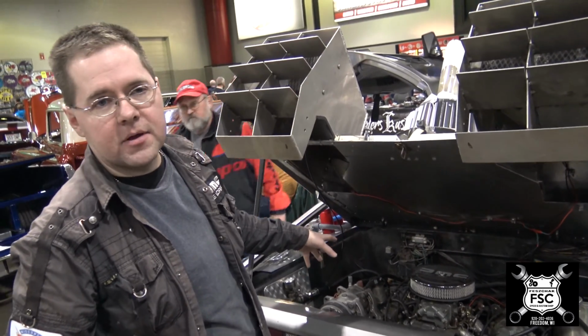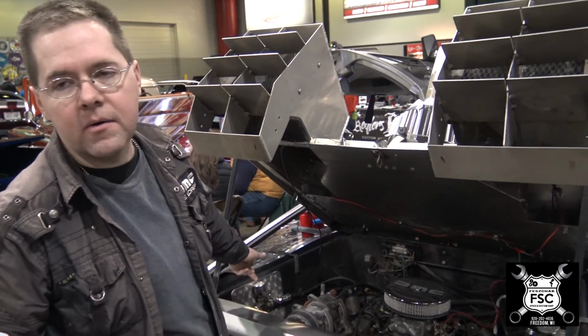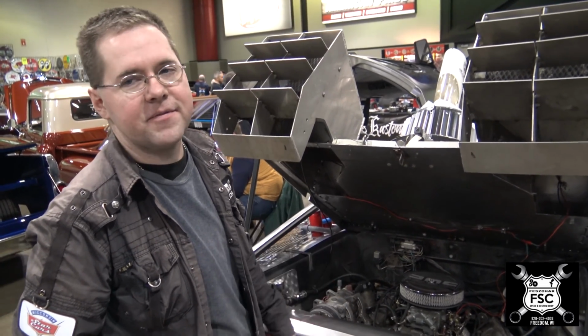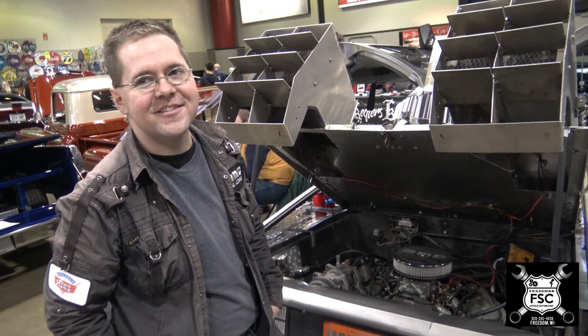It had a carbon emission canister also in the sidewall. Well, I took that out, which freed up a lot of hoses that I don't need. So the vacuum hoses are a lot fewer than before. It still is a car from the 80s, so it still was a vacuum hose nightmare.